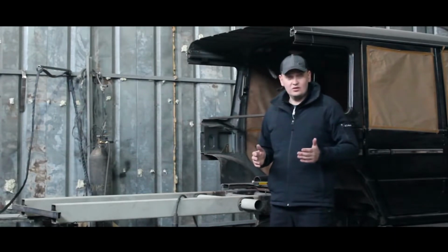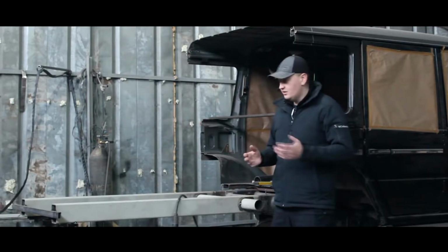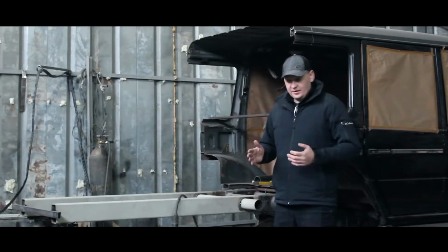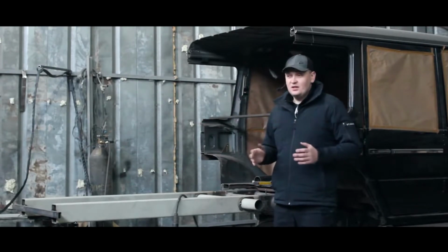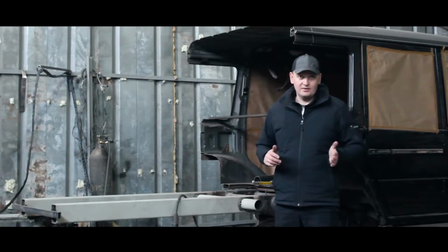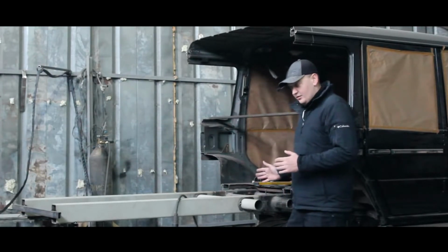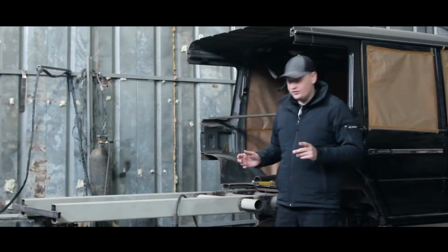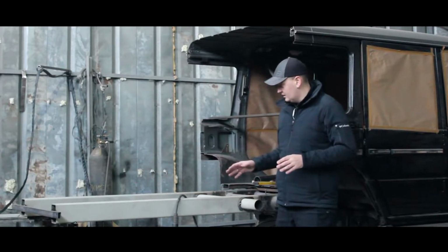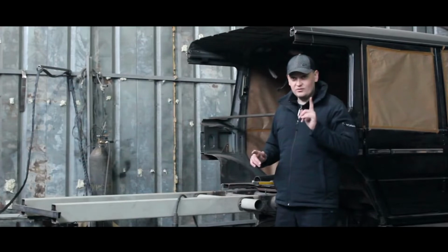We went to the inspection center, for those who don't know what it is, this is an examination that checks the cars for honesty, the VIN codes, whether the body is broken, whether the frames are changed, that is, there are many cars with problems like that, we asked them a question. If we cut the frame in the center, disconnected it and put it together again from the back, they said you don't have to come to us, this car will not pass the examination. You can still cut at the back, but never in the center, because the frame will no longer be considered one piece. We went further through our more correct strategy for constructing our cube. We moved the metal suspension back. I will show you all this in the video, and we will insert an additional suspension in the place we need, like we did with the previous Gelandewagen. That is, our wheelbase will completely coincide. We do not cut the frame, this is a very important thing.